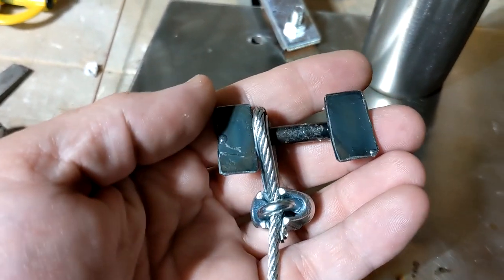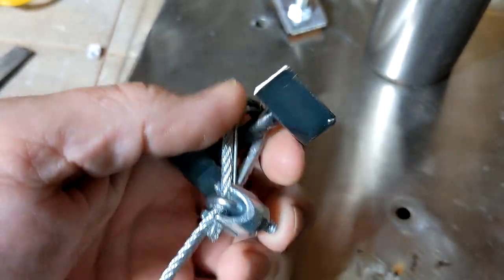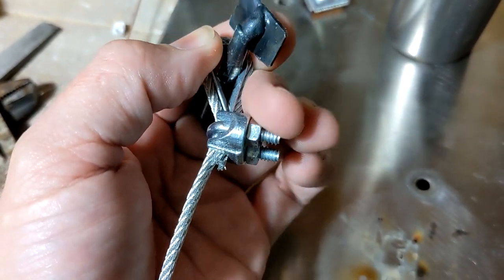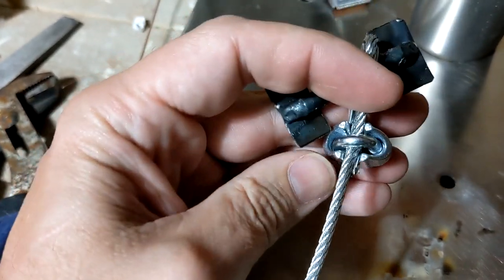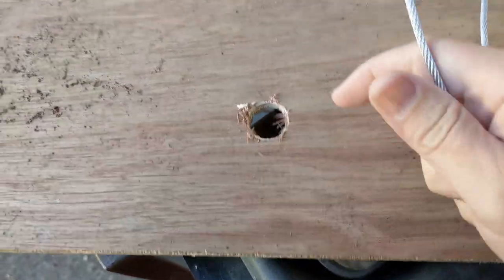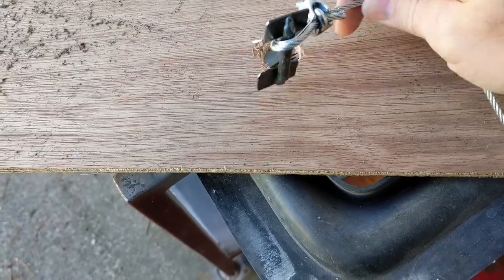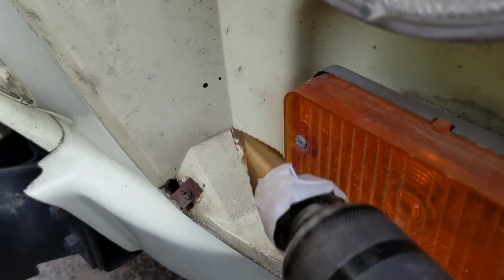In order to do that I'm going to need to drill a hole in the SMC fiberglass that is the width of that piece, which is also pretty much exactly the same width as across the bolts. I could theoretically cut these bolts down and that would still work, but if I ever took this apart I wouldn't be able to get it back together - you really need all those threads to cinch down this u-bolt. It's about three-quarters of an inch, which means I'm going to be busting out the step twist drill bit. I drilled a test hole in this piece of scrap wood just to see if I could get the u-bolt through the hole, and I can just barely get it through - so that's the smallest possible hole I can drill. I've marked that with tape on my drill bit.